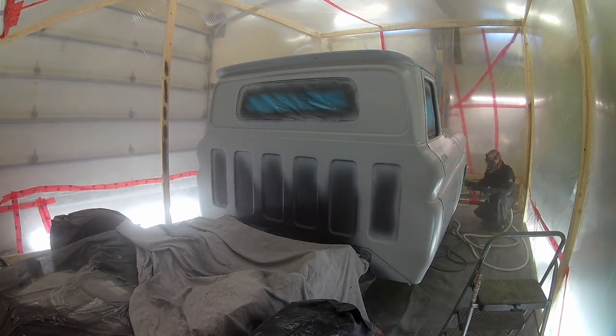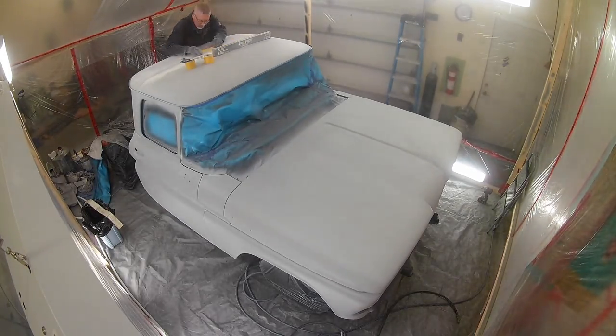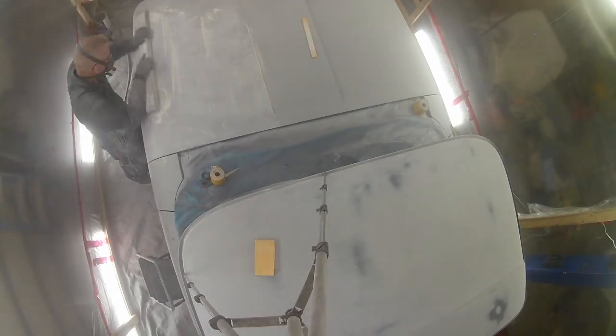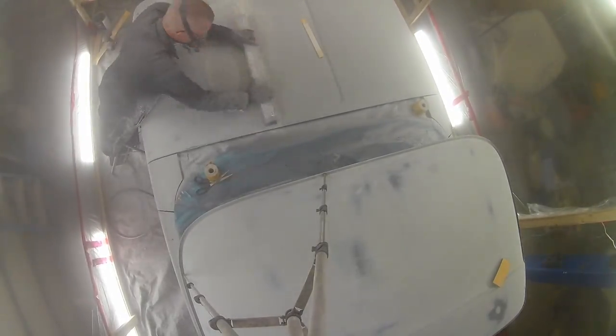Laying down the slick sand — the stuff has like a 30-minute pot life, so you've got to boogie. The stuff was curing in the gun within 10 minutes of spraying, so you really need to move. You've got to mix the slick sand with the hardener by weight, and my scale could only weigh half the gun cup at a time. So every time I go to fill the cup, I had to spray acetone through it and clean it all out, because oh my gosh this stuff is bizarre. However, looking back on it, being able to sand out your defects so well with slick sand — it actually does a pretty good job of hiding all your mistakes. I'm really quite pleased with the level of not-visible defects that I have.